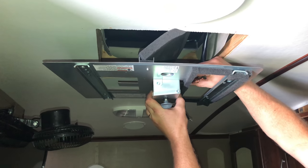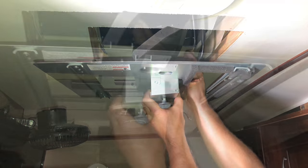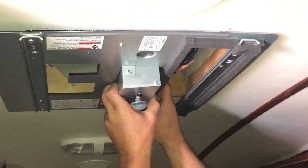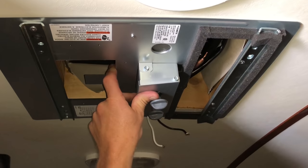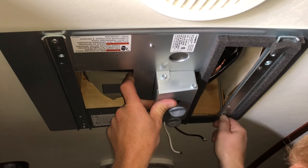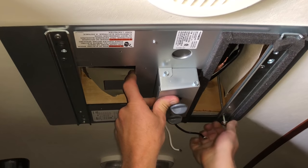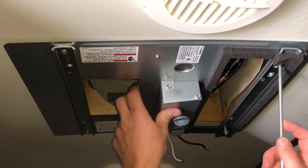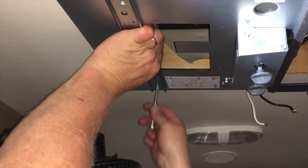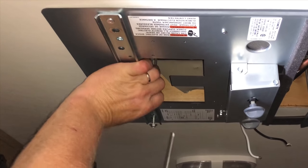Make sure that the air conditioner gets plugged into the control unit — it just snaps into place. Then I can push my duct divider in; I want that to go straight up so it divides the intake from the outgoing air conditioning. There are my four spots — I want to line these up with the very long bolts that go up into the air conditioner unit on the roof of the RV. Once I get those lined up, I can tighten them down.